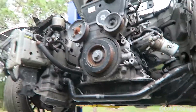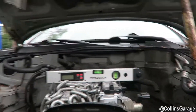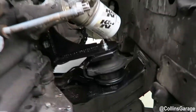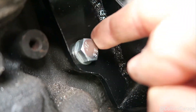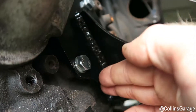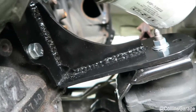Let's lower the car down and really show you how this thing is put together. So basically we have the engine and trans with the car lowered. You can see how we put this together. First and foremost, it is level — really level. We're using the stock rubber mounts. There's a little bit of slot adjustability up and down on these mounts just in case you can't get it level. You can adjust it vertically on the engine to make it perfectly level on your swap.